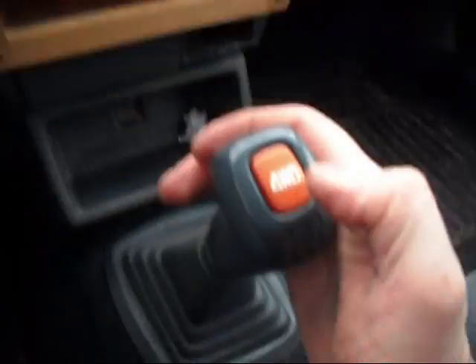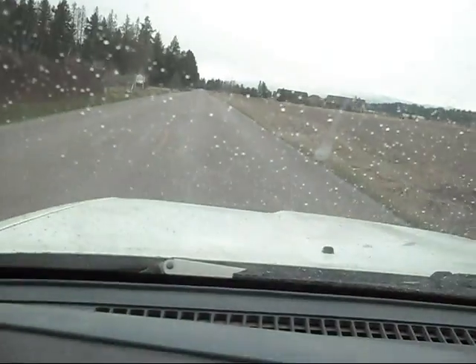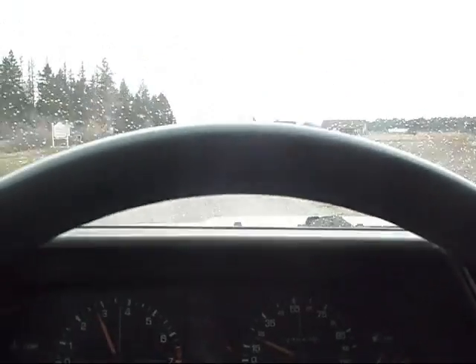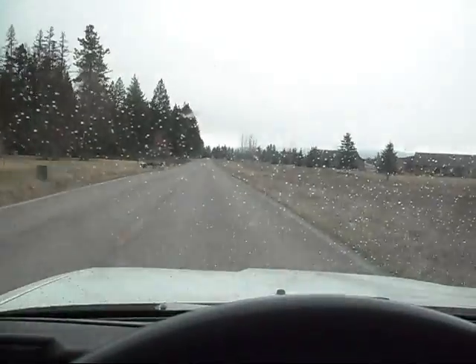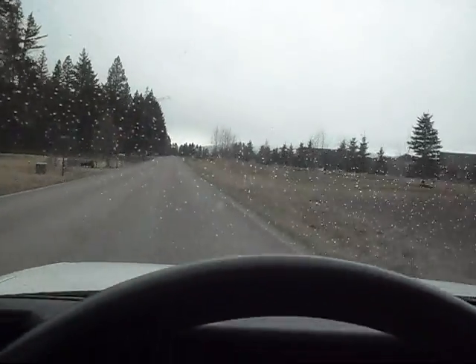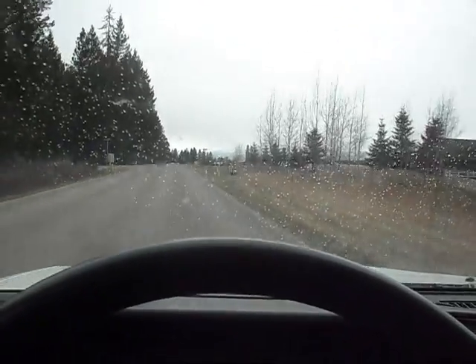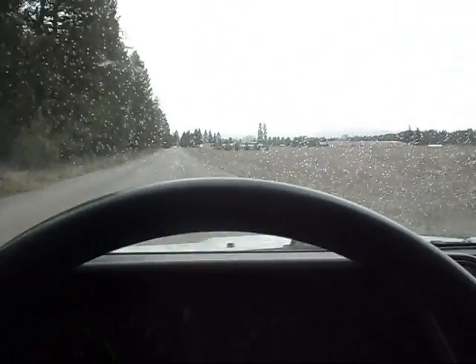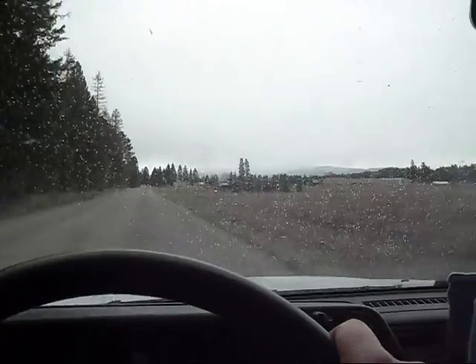Let's try the four-wheel drive. It's push button, so you just push it down — see the four-wheel drive light? This four-wheel drive works real nice. One thing about these cars: you don't take four-wheel drive past 55. But it works very well, and this thing is incredibly good on fuel. It'll even be better if you put 185/80-13 tires on it — this has 175s, I believe. Get some bigger tires and you'll save some fuel.